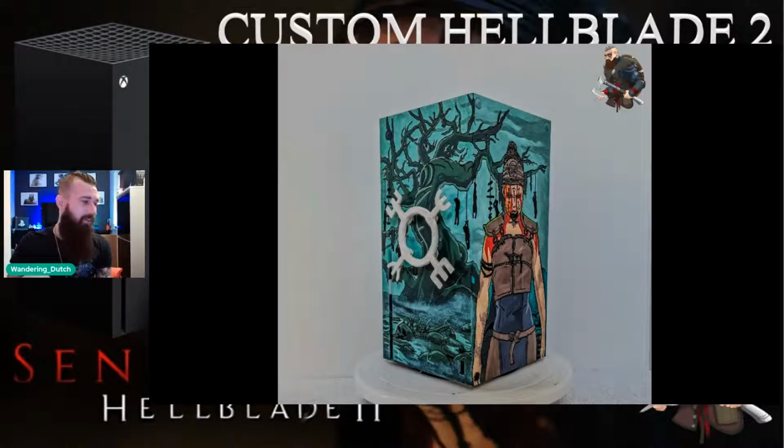which you'll be even more horrified to do. So to get the LEDs through, I actually have to drill 4 very thin holes like that, drilling the holes through the shell, obviously taking the console apart again, drilling the holes through once it's been painted, not beforehand, and then getting the LED diodes through the shell itself, and ensuring that they emit enough brightness to light the logo up, because without that, I wouldn't say it's a waste of time, but it doesn't give us the same effect.